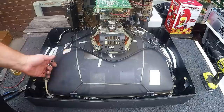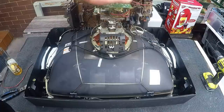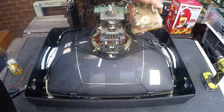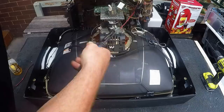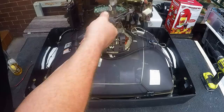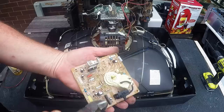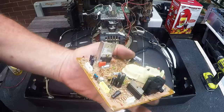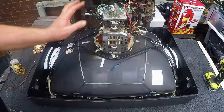So here we've got a nice CRT unit with a really nice degaussing cable system. There are two pieces of degaussing cable, plus another little one up the top. We've got the board on top of the yoke — with this Sony there's a secondary board. I just start at the top and cut my way through, removing wires and plugs. Our first item is just a CRT yoke board — there's no real value on this, a little bit of wire, a little bit of aluminium on the heat sink. We can just throw this as a power board.